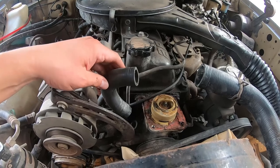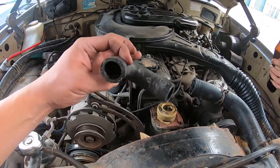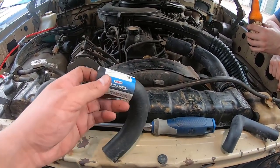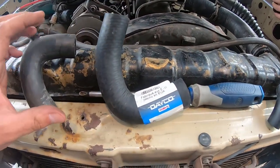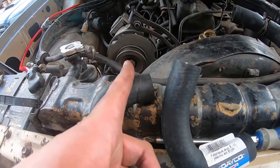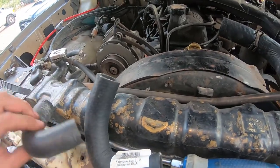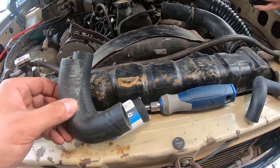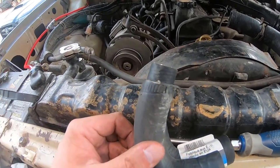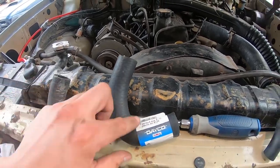This is one of the hoses I'd replaced initially, and it was really snug on there. I don't remember where I got this one or the brand. We already took the sticker off, but this is a replacement I bought. I bought another one. And see where it was clamping, how it was all deformed. You can see the clamp was not parallel at the end of the hose. It was kind of at an angle. And when you put these two side by side, one end is maybe about an inch longer on each side. So this hose is gonna be a much better fit.